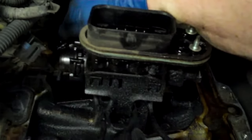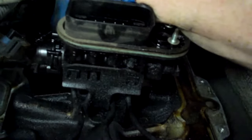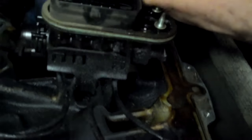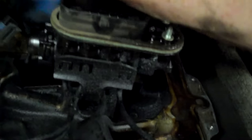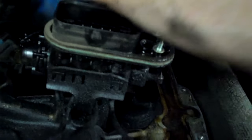Plastic — you say plastic lasts forever, it'll be here for eternity. But dude, it gets brittle as heck and falls apart as good as anything else I've ever seen. So you want to be careful as you're pulling these out that you don't drop the plastic in there and get it stuck in a valve — have a valve stuck open or something like that. You want to pull all the injectors out first.